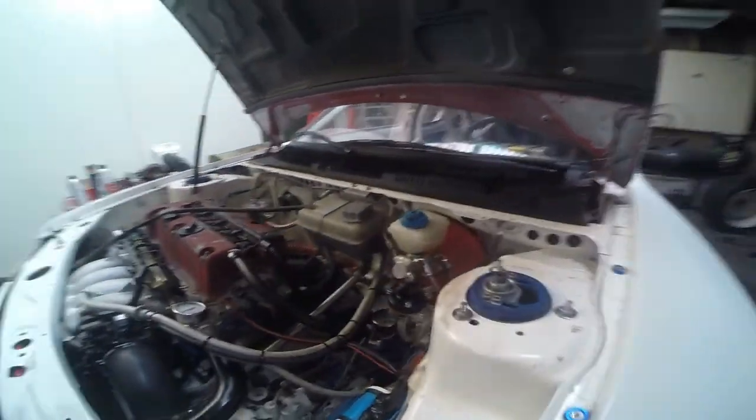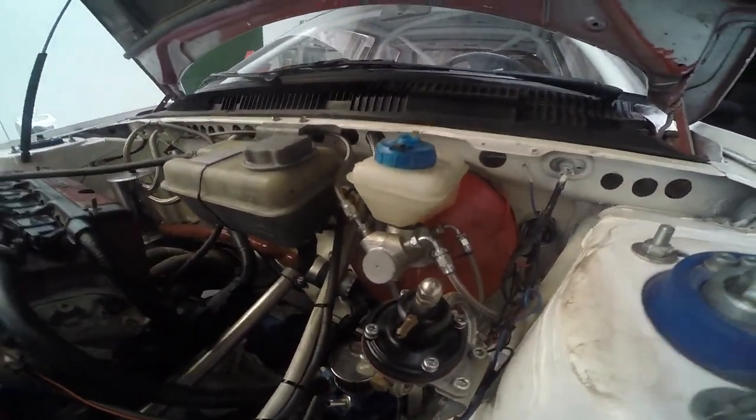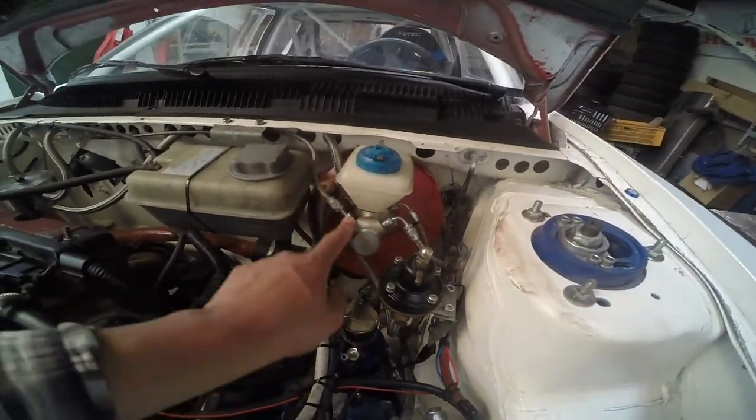So as you can see right now, we installed this and this is probably going to solve most of our problems, because the master cylinder of the old one was blown out. I cooked it, unfortunately, but those things happen. And this thing is fine. We also replaced all the fluids and swapped the lines around. These are the two fronts and the other ones are the rears. That turned out to be better. For road cars, PSA cars use the crossed side, but for track cars, this way is better.